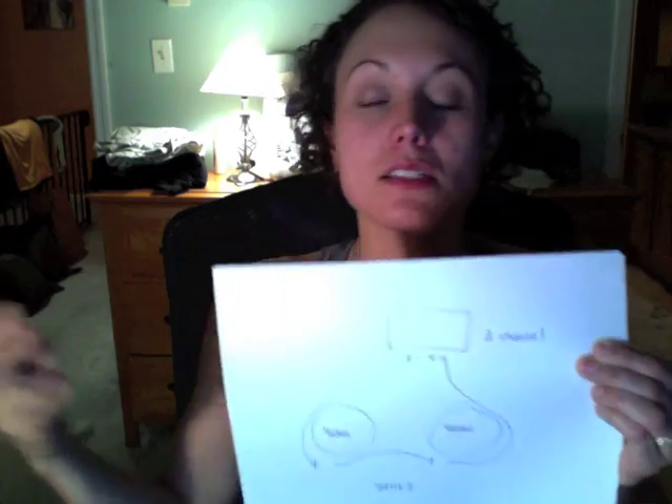The amp is happy — it's going to play. It won't play as loud as if you had the mono amp running in parallel, but it's going to play. So if your buddy gave you an amp and your other buddy gave you some subs and you want to get it working but it's not really the right setup, there's usually a way to do it — and that's usually series.